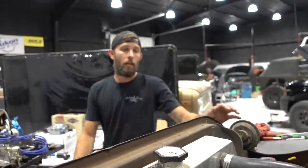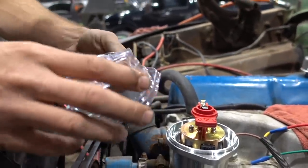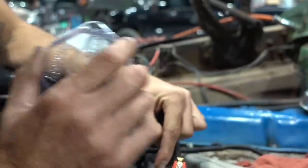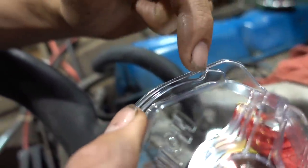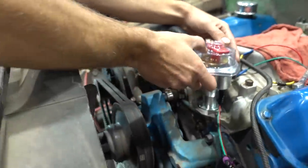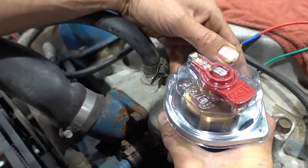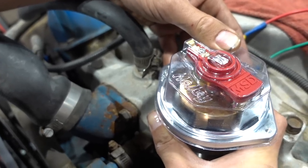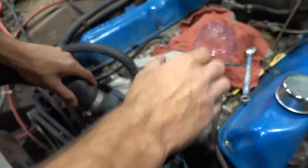now we're gonna take this plastic cap, and this is how you phase it. So this sets over the top of the rotor, and it has these two little pins that are in the body of the distributor down here, and then there's this little notch in this plastic cap. Now this thing's gonna set on here, and I'm not quite lined up just yet, so I'm gonna rotate the body of the distributor until those pins land right there. Now there's a little bit of slack, so I'm gonna find right in the middle of it, right there. Now that those are lined up and the rotor's lined up, that thing has been phased